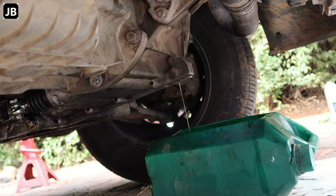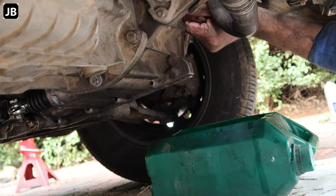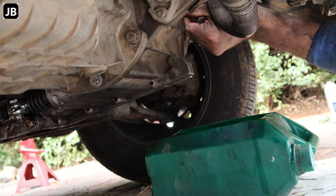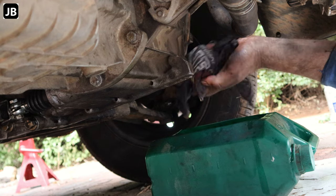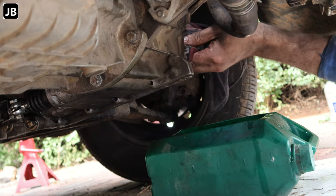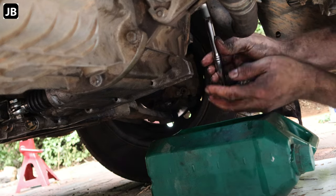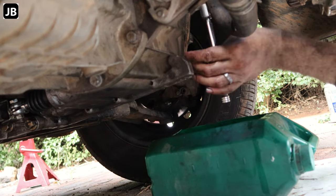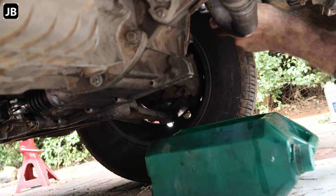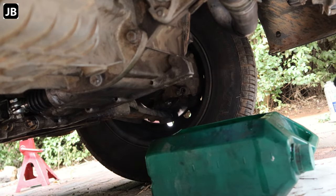Take note, your car should not stand on jacks when doing this, otherwise you'll overfill it because it's leaning backwards. If it's still overfilled, it'll blow out on the back of the speedo sensor. I've had that before as well, because I had it jacked up when I filled it the previous time. Otherwise, replacing the drive shaft seal, and then for about a week afterwards it leaked, well, all over the place. There we go.